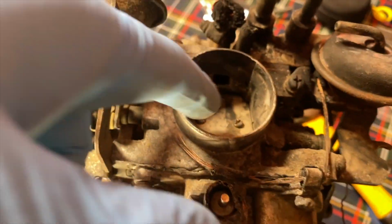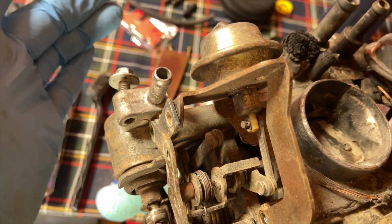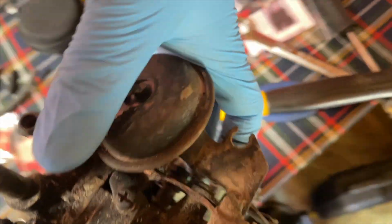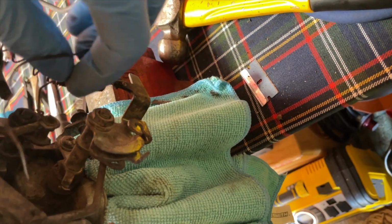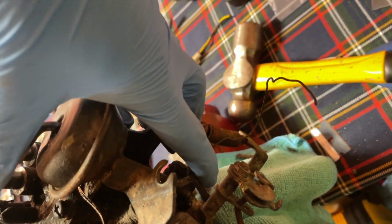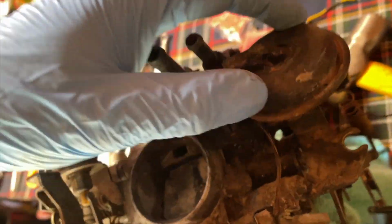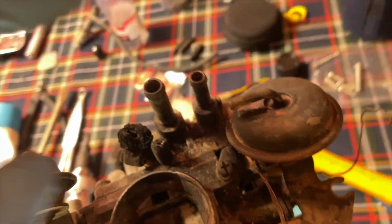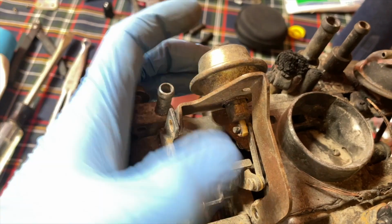So we have our choke flap. Now, when you're replacing, even this piston choke is good, so I'll save it. Like I said, it's a good way to test it. This one, however, is toast. If I put my finger on the end of that diaphragm and then let it go, it falls right down. So obviously that melted probably in the fire, so that's no good. But the piston set choke, that's good. It's holding, so we can save that. I'll clean it and save it.